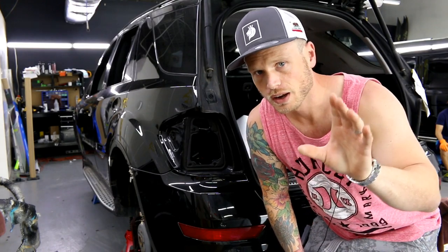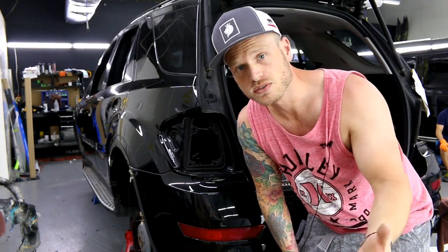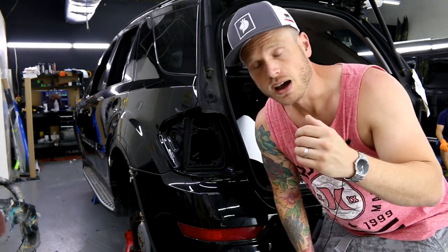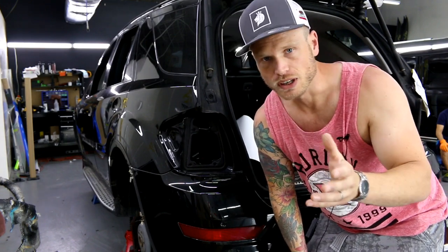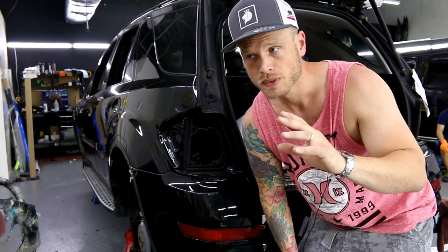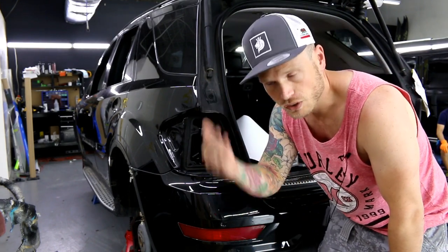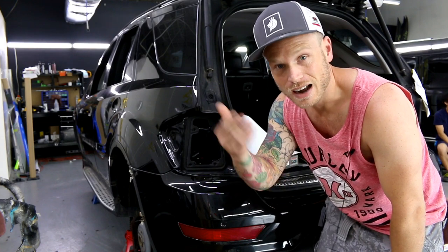What's going on guys? Today I'm going to do another video on an overlay. An overlay is a piece of vinyl that we put over top afterwards. Putting a piece of vinyl over top is sometimes necessary, especially when we're using chrome finishes. Inlays and overlays are used a lot more often on chrome finishes than on regular finishes, simply because of the limitations of the film. We don't want to break the finish — breaking the finish leads to a much worse looking installation than an actual seam.